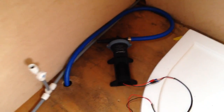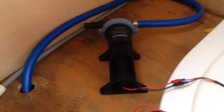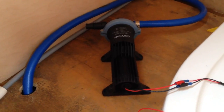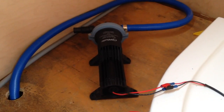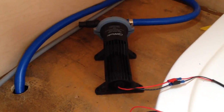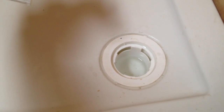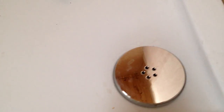What I've done is replaced that with the good old fashioned gulper pump. I'm not going to mount it exactly there — that was just for a trial. These are rubber diaphragm pumps, they're well known. It just sits there chugging away, waiting for water to come along, and then just pumps it out the side. I've tested it and tried it and everything works really, really well. I'm going to mount the pump above the floor for ease of maintenance, and I'll probably put some sort of noise baffle cover over it, which will double up as a shelf or a set of drawers. The drain system has a trap in there where you can take out anything that might jam up the pump — quite easy, it just comes out. Push it back in and it's good to go. So that's the shower system. I'll let you know when the rest of it happens.